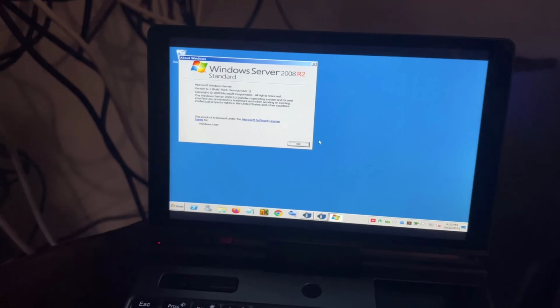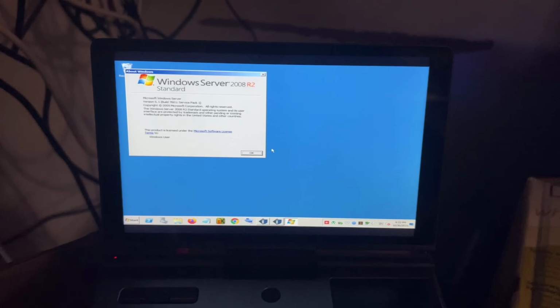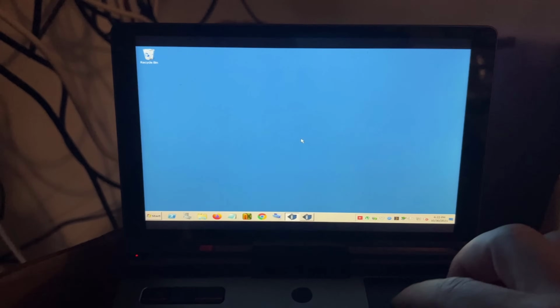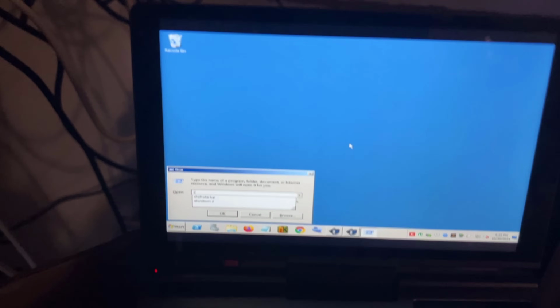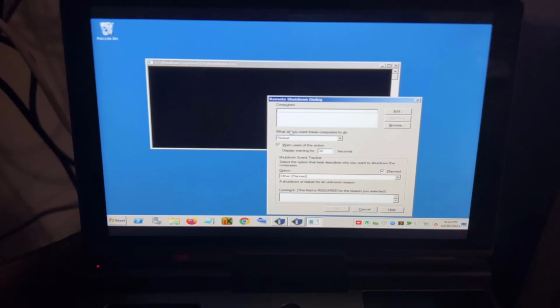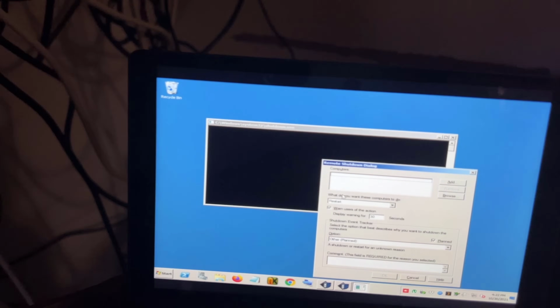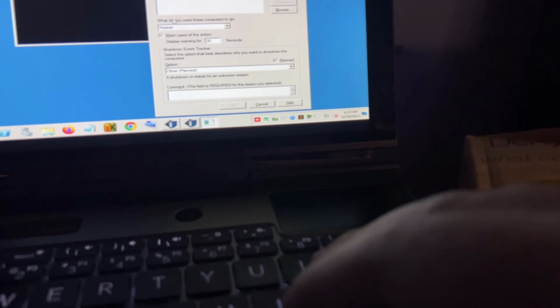Now this is one area where I was a tad bit disappointed. I had higher hopes for it. It's not an ultimate loss here, but it's not as useful as I was hoping it would be, especially when connecting to a bunch of random machines using legacy types of outputs. I am using an active VGA to HDMI adapter here. Now, the important thing to note is that the touchpad isn't working out of the USB portion, only the keyboard portion is working when connecting to this old server, which is fine. I don't really need a mouse. Having a keyboard active is totally fine.